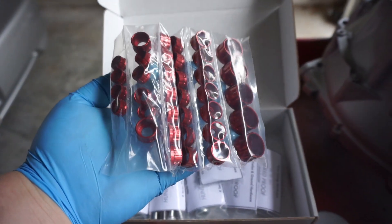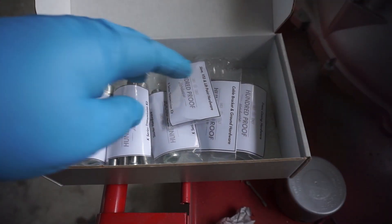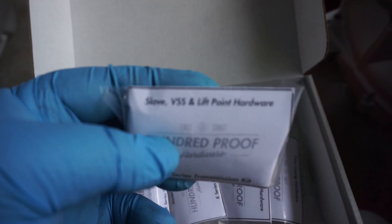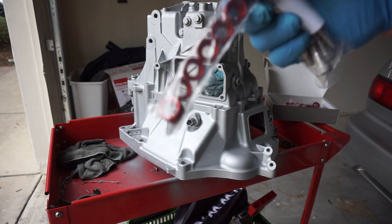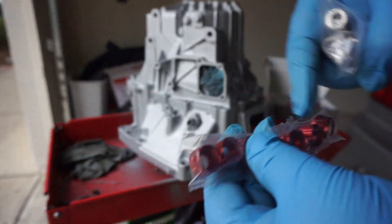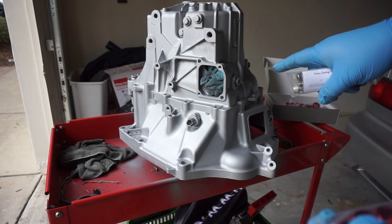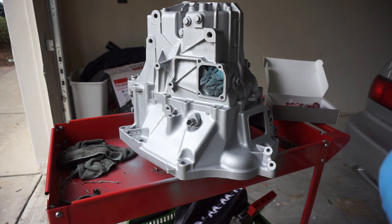What they do is pre-lay out all the washers for you, separated by size. The great thing about MPC is that you get all these little packets with everything pre-labeled as to where they go. Here I've got the trans casing hardware. All the red washers and stuff break apart into single pieces, so we pop them out one at a time. On the K-series transmission there are a couple of extra long bolts — we go ahead and pop them out.